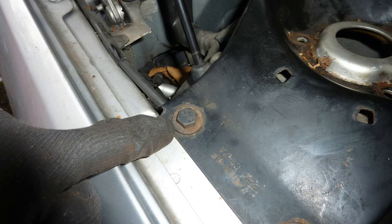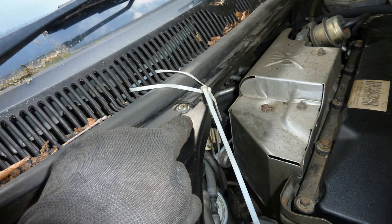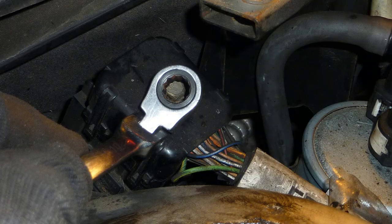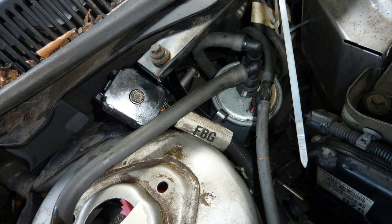This must be the left hand side above the engine mount. This is the right hand side where the computer is. I'm saying take these off. Notice the heat shield where the turbo is, to the right of my hand. Okay, that's off. There's the computer terminal, ECU, I'm pointing to it right now. Undo that, I can't remember where it was, 10 maybe. Undoing these pipes, fuel pipes I think, just the right hand side above the drive belt.